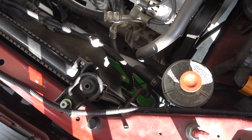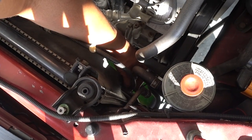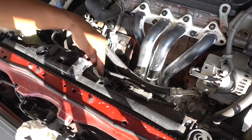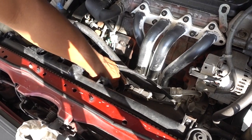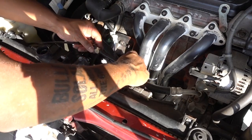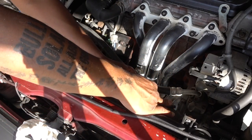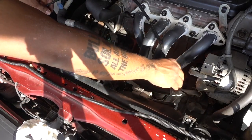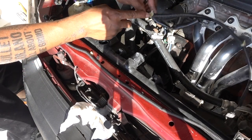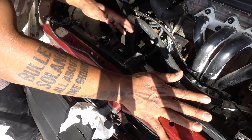The other clamp is on the other side, so I'm going to go underneath and remove it. You see this connector right here — you have to remove it from the clip by pushing on the back and pulling it up. Get this connector out of the way. Next, disconnect the fan connector on your left. Press on the top and pull it. Get all these wires out of the way — on this side it has one of those clips you just pull.